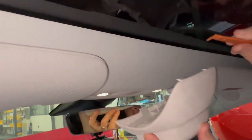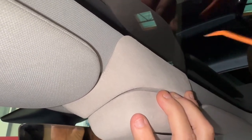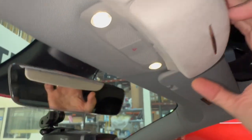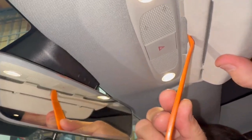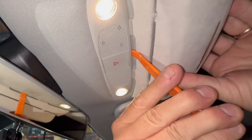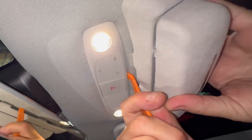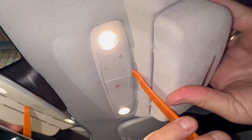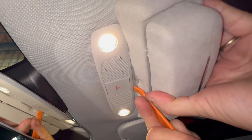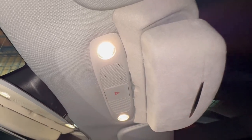These tabs are going to go level with the glass. You simply hook this on and it goes right under the glass. This is the headliner and this is our piece, which is hooking right on it — so it's holding on like a shelf. Then you come down here and there's a little cutout. This notch is for inserting the tool and prying it away so that these two tabs will go underneath. You just pop this down and insert the two pieces. Once they go underneath, they catch on this plastic lip and it's installed.